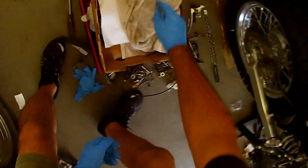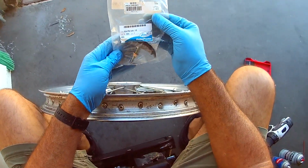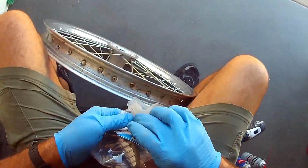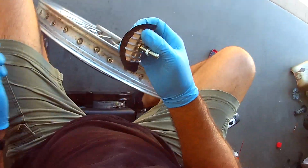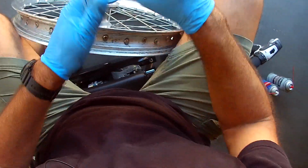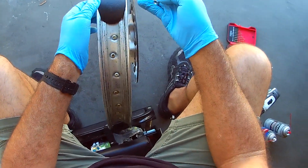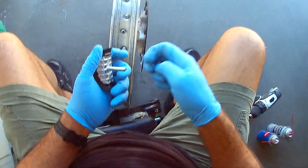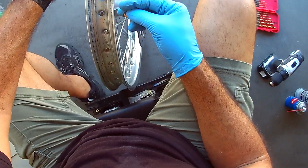All right, so I'm going to get my rim lock. Get that when I'm done. Okay, so now the rim lock is for a 1.85. DR650 has a little bit wider rim than, like, say, your motocross bikes at 1.60. So we'll put that there. I'll spin this guy off. Ooh, look at that. It fits nice down into it. Nice. So we're good there. So I'm going to leave this guy off. So like I said, I stopped with the 5/16 hole, and that is good.